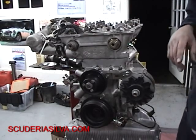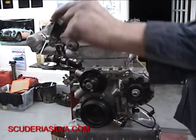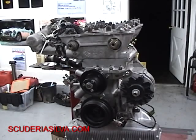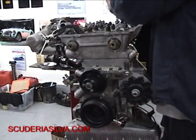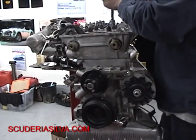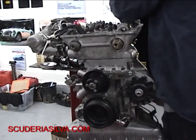I had one extra stud in my hand so I put them on the front four and the back four. In the middle section that's the engine lifting piece, so we'll put that right here. Now we'll put our head nuts on and torque them down. We're going to run these down to 45 foot-pounds first — snug them all up in our normal random pattern. We've got the new snap-on knurled extensions which are sweet — you can hold on to them when you're all greasy. We're going to be making some horsepower pretty quick here.